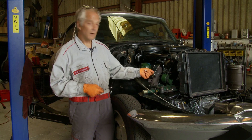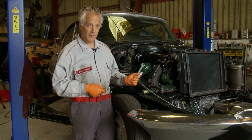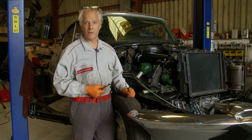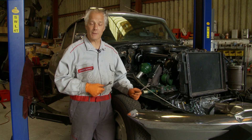On this side of the car, underneath the LHM pump, you can actually get to the brake calipers and do the adjustment. It's relatively easy, a little bit tricky. The other side is a complete nightmare because it's under everything — the battery, the steering rack, the steering column — and essentially you have to take all of those off in order to get down and adjust the pads on that side.